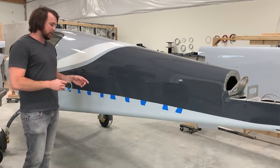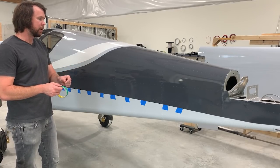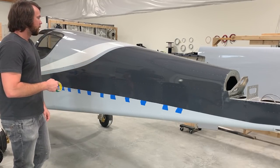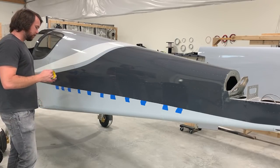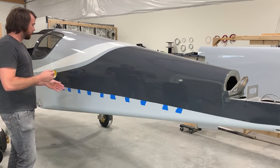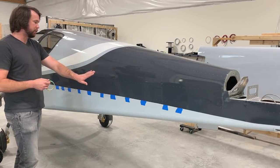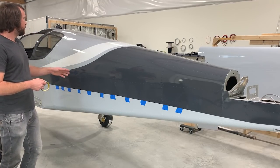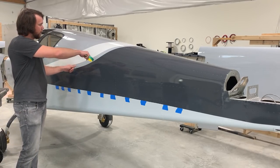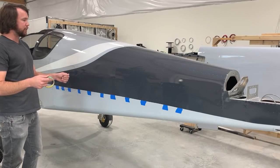Now that we've got the spacing established, you're going to install your knifeless cut tape. This is a tape that has a small string running down the center so that you can snap the string out and it'll cut the vinyl exactly where the tape laid. Keep a little bit of tension between your two hands as you're rolling it off onto the plane, periodically touch it down at established points, then smooth it at the very end. About a foot between my hands gives the best results.